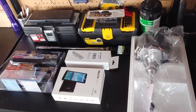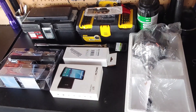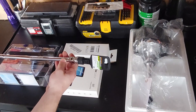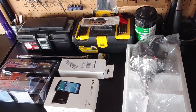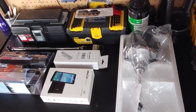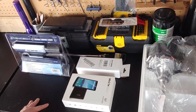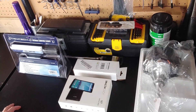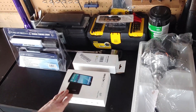I just wanted to show you guys some stuff to make your job easier. You're going to need your basic tools — wrenches and sockets. But some specific things: I got a breaker bar, a three-eighths drive for about 20 bucks, so I can turn the engine over. For my vehicle it was a five-eighths socket to turn the motor over — yours could be totally different. You're also going to need a timing light. This is probably a one-time thing, so why spend a lot? I went to Harbor Freight and got an advanced timing light for $35 — the cheapest I could find online was $70-80.